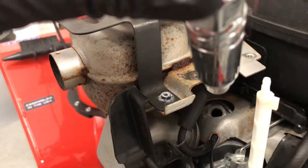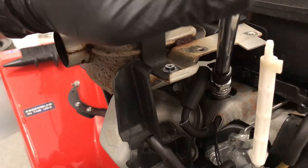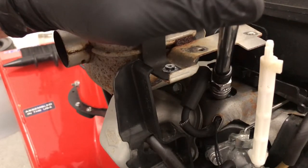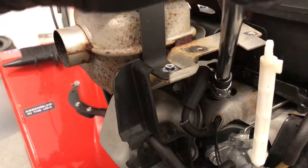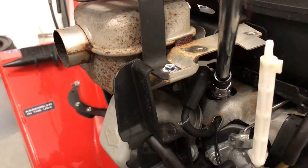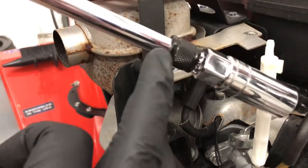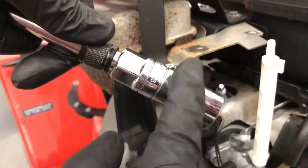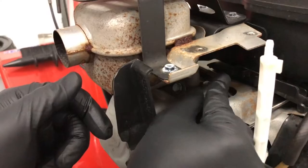Get the plug lined up, push it in, and very gently put it back into the hole. Turn it counterclockwise — you'll hear a click. Once you hear the click, you're ready to thread it in. Turn slowly and it'll be smooth. Once it's all the way down and you can't go anymore, put your ratchet on — not even an eighth of a turn. With locking extensions the socket won't get stuck on the spark plug.